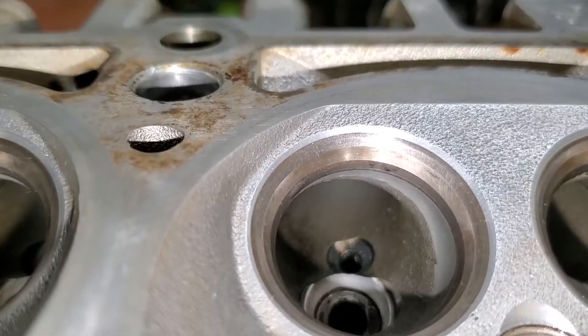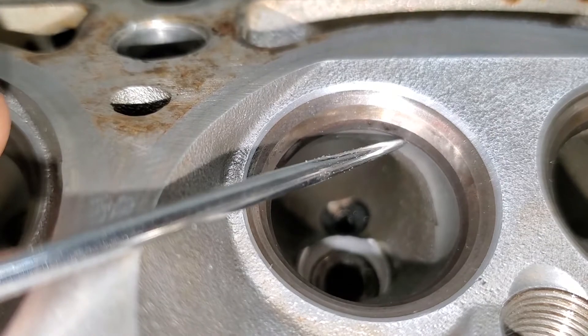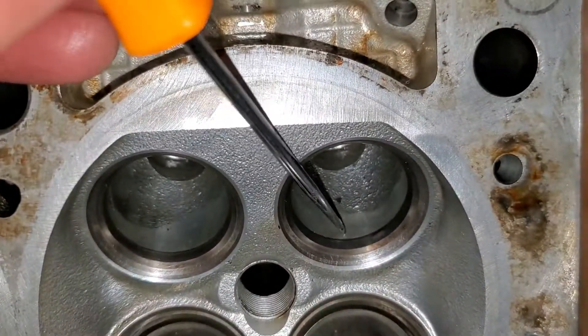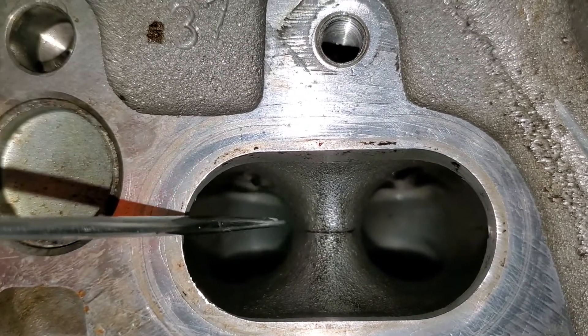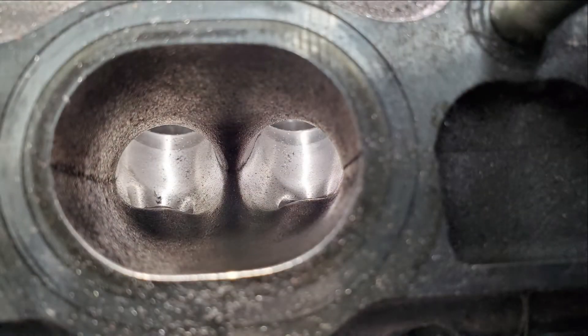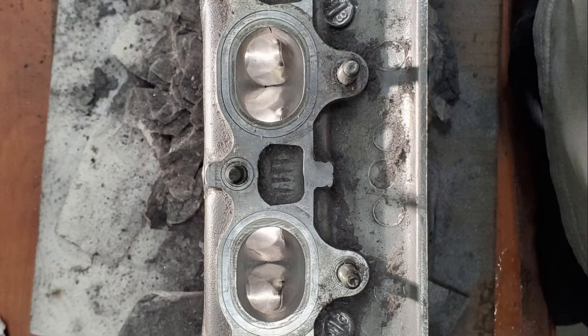Here's a really good look at the valve seat on the exhaust side. You can see my pick is getting stuck right there — you can see how much of the pick is stuck in — and you can see 100% that there's a gap, there's a lip. The exhaust divider right here is just monstrous, and we're going to have to take care of some of this area where the exhaust manifold and gasket seats up. In contrast, this is a Honda D15 head — D as in Delta — and this is the center divider from the factory on the exhaust, and after I worked it. In both cases it is significantly thinner than on the M104. That's going to cause very little turbulence — so that's the goal for the M104 head.